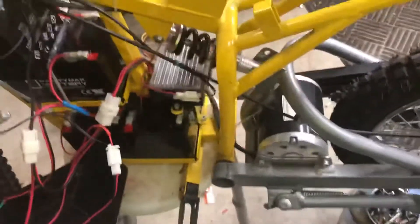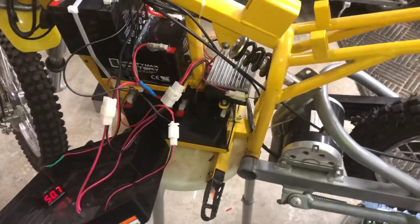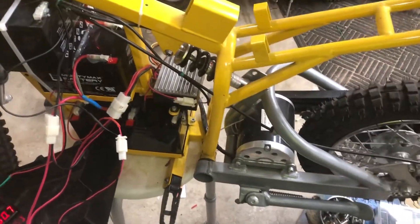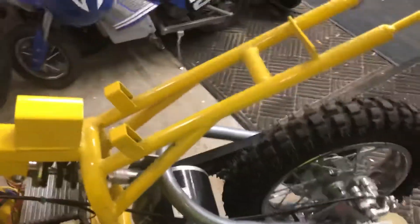There's a good look at how it fits — everything tucks right in and you can't even see it, but this thing rips. On the other build I did with LiFePO4 batteries, everything is stock: 650 motor, 650 controller, 650 throttle, nothing is shunted, nothing has changed. I weigh 180 pounds, I've ridden it probably 20 full charges on grass and turning like almost motocross-like trails. The motor smells a little bit and gets a little hot, but nothing's broke — everything keeps going.